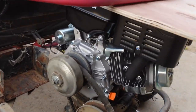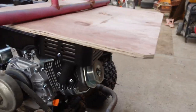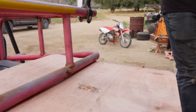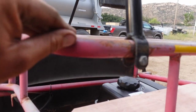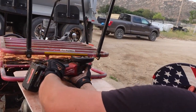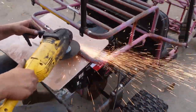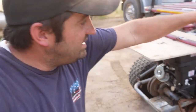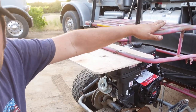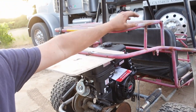So we're running into some minor issues here. This engine is a little bit taller and a little bit longer than its predecessor. We're going to cut these off right here and we're going to try and bend this bar up and then re-weld it. We'll cut off these rear braces back here and try to squish this up. I'm going to grab the 272, stick the forks in here, rest it on top, and then push up on this with a jack — hopefully that does the trick.